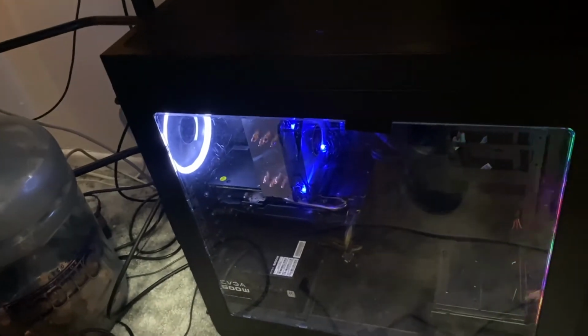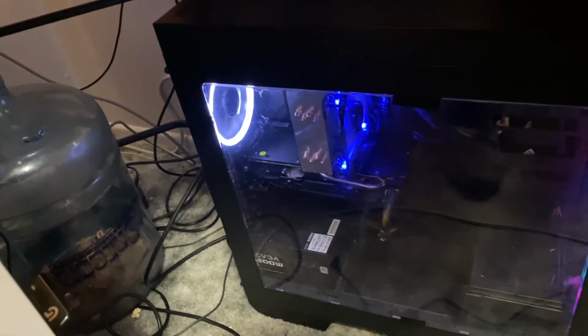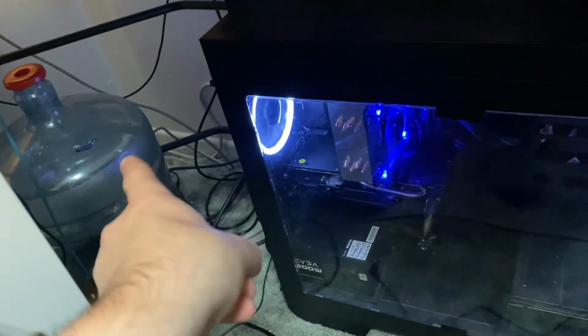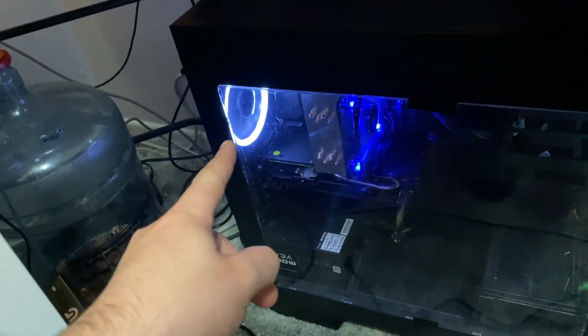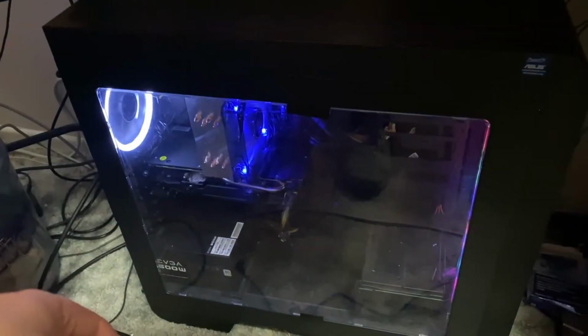But it may be due for replacement too, because it was exhibiting some sounds of bad bearing noise, which is kind of annoying. Pushing it in, kind of just playing with it when it was on, got it to go away. But I can guarantee you that fan's probably on borrowed time, and it might be best practice anyway to replace all the fans so that they match. But also, maybe in the future, I might just end up swapping out cases entirely.